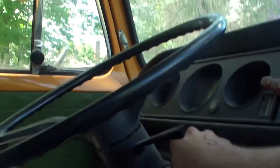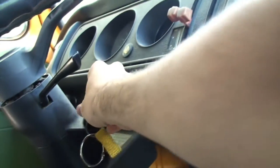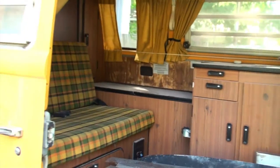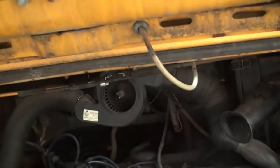Let me find the key here. The bus does have a charge — I recharged the battery. I'll go ahead and turn the key. You can see the light turns on over there and there is charge in the battery. But I'm not going to crank the engine until I have put oil in the cylinders, because the engine in this bus hasn't been started in over three years. So while I could probably get away with just trying to start it, I'm going to actually put some oil in it first.